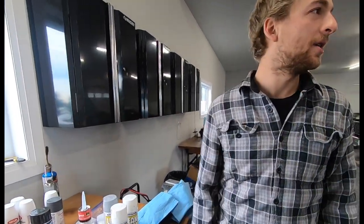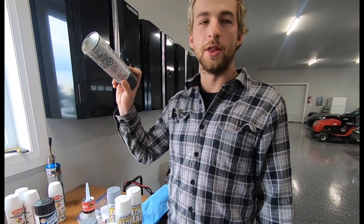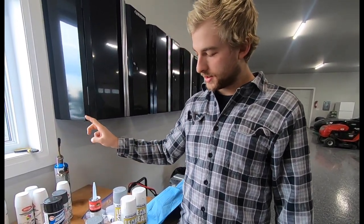All right, so we got everything clean and all that, going down in the van. So now all we did, we sprayed a bit of some primer here on the spots that had the paint removed. And after that, we're just gonna do two coats of paint on the floor of the van to seal it. Obviously we scraped off most of the rust, but we want to starve that rust that we didn't get so it doesn't spread too fast, or at all.